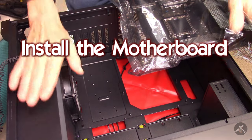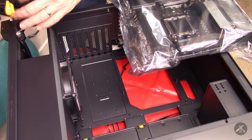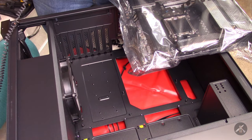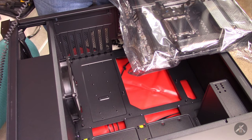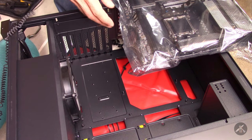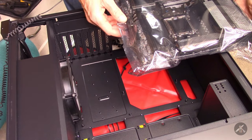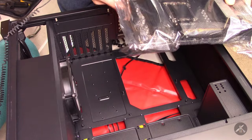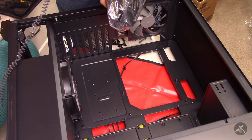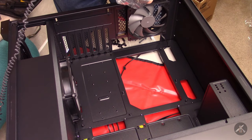I'm going to dig in now. I've got the case laid out, it's sitting on my anti-static pad, and I've got my wrist strap on. I'm going to open up the motherboard. When you do that, you want to be anti-static. The thing with static is you can put a fairly high voltage into things that you touch and it may not blow it out right away, but it can weaken the solid state components and somewhere down the road they'll fail. And you'll wonder why — the answer is, once upon a time you put static into it.